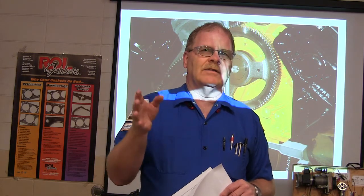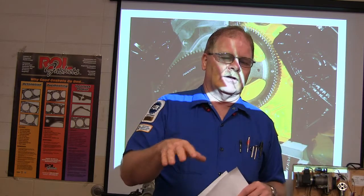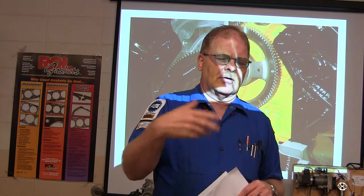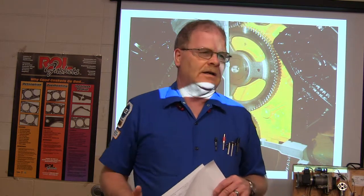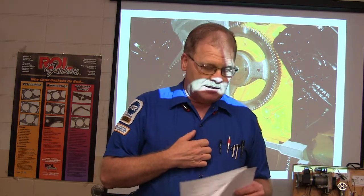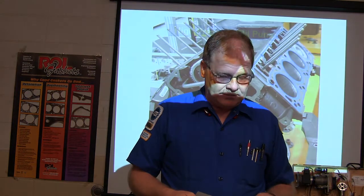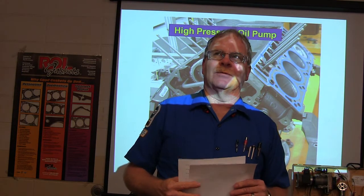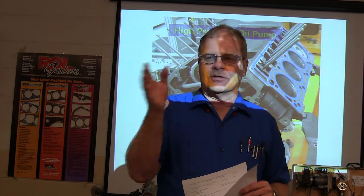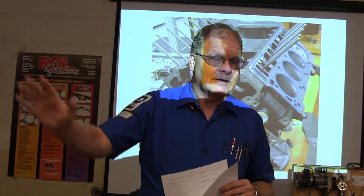But the tire manufacturers say you always put the best tires on the rear. If you're only going to replace two tires, put the best ones on the rear and the most worn out tires on the front, as counterintuitive as that might seem. You ask a lot of mechanics, they'll tell you it's the opposite. But if you're ever in a court situation where somebody's getting sued because they put the tires in the wrong place, the court's always going to look at what the tire manufacturer says. See what I'm saying? So go by what the tire manufacturer says.